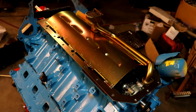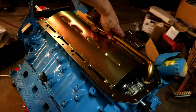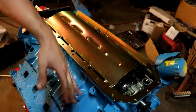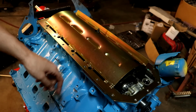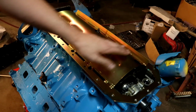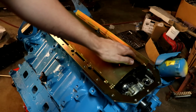The benefits of this windage tray are pretty neat. So they've got the crankcase pretty much fully encapsulated besides where the oil pump is, and that makes it easy for maintenance if you want to take the pickup off. So if we remove this, you can see that there are baffles here, and as the crank is rotating, you're allowing oil to splash back easily into the oil pan to be picked up again. And then what I think is pretty neat here is that they've got this little baffle, like a guard. So as oil is winding around the crankcase, it's going to be caught by this baffle right here and then sent down in this motion right here.